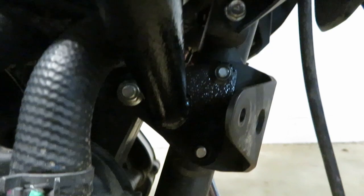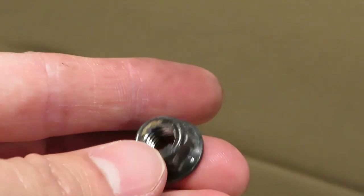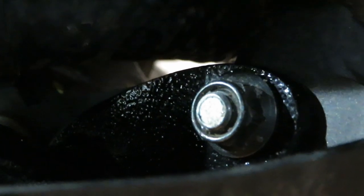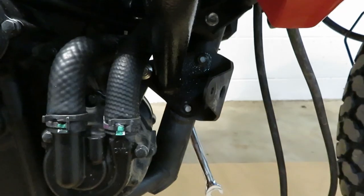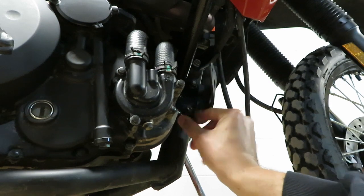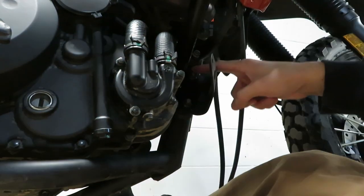I pulled off the bottom nut because I'm going to throw some blue Loctite on these. There's plenty of bolt there, however these nuts are a locking nut - not a nyloc nut, they've got little teeth that are supposed to grab the threads. I have more than enough confidence in the holding power there, but it seems like those teeth are kind of to the point where the bolt starts to taper down a little bit. This may be overkill but it's also super easy to do, so I'm just going to throw some blue Loctite on the threads.